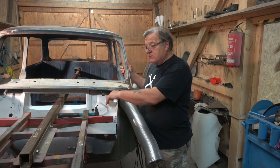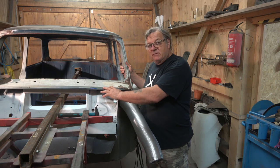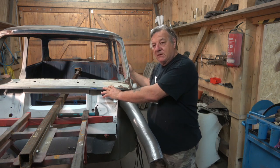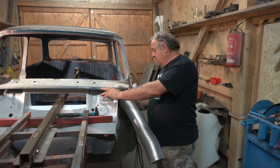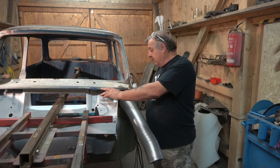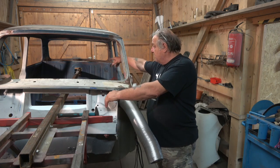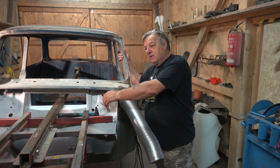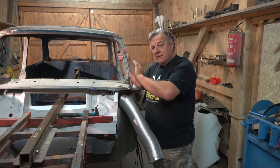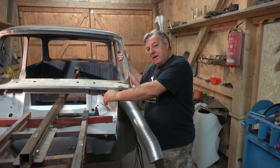The two things I really need right now to get this build on its way: first, the Safety Devices roll cage - it's going to be an eight-point roll cage, with legs at the front, down inside the companion bin, onto the rear tub or rear arch, and around onto the bulkhead. That's around £950 from Mini Spares. I'd need that to drill all the holes, put the plates in, and work out what needs to be cut from the companion bins.